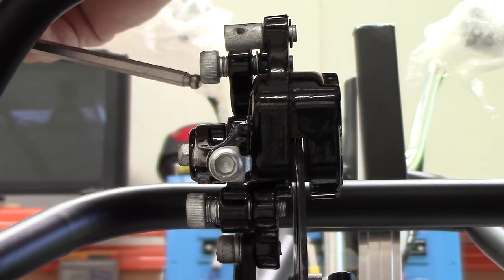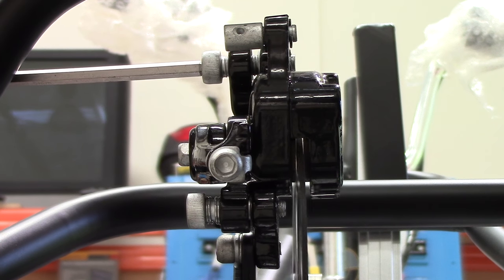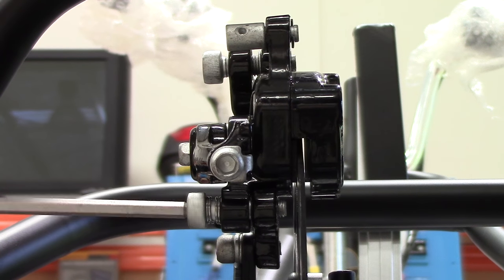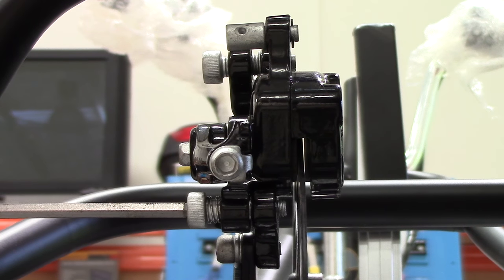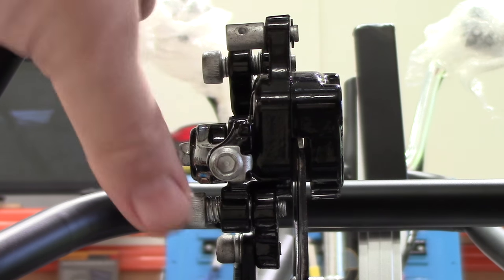You can then fine tune to give you the best effect so you can rotate the axle without any scraping sounds. It is quite normal for the first few kilometers to not be able to get rid of the scraping sound because you will need to bed the brakes into the disc. Once you're happy with it, everything's locked down and you're ready to go.